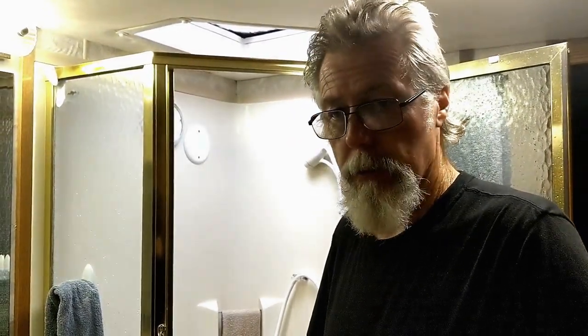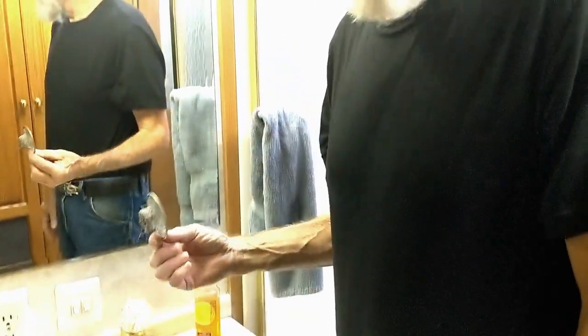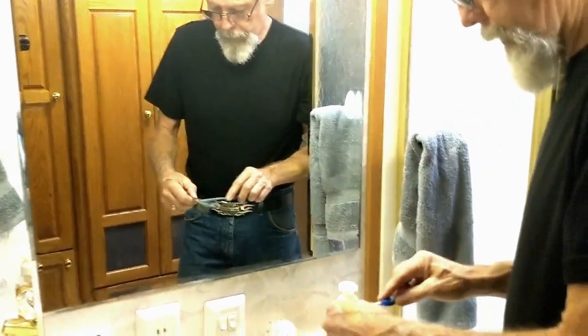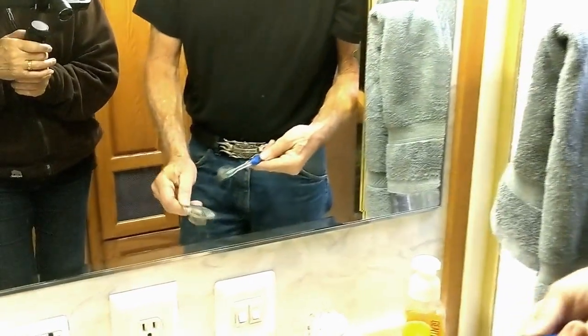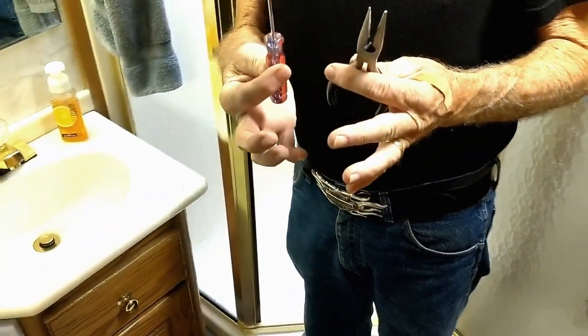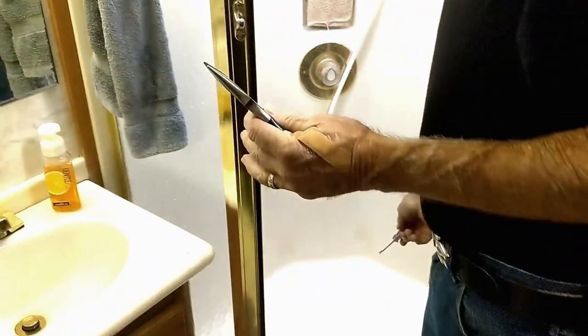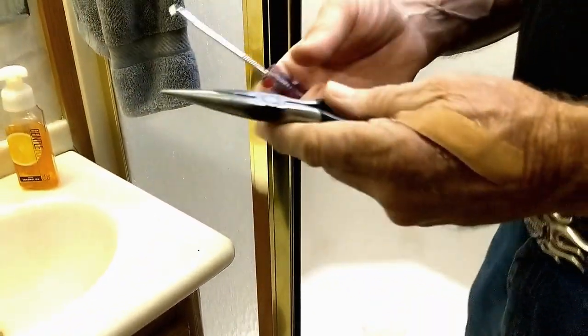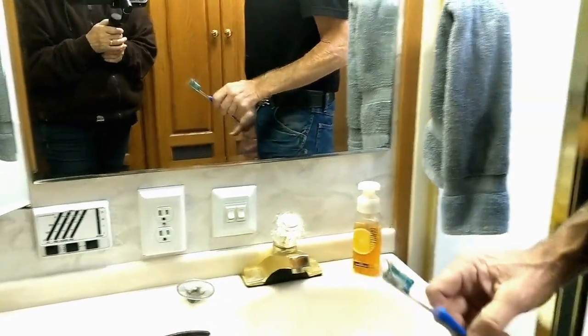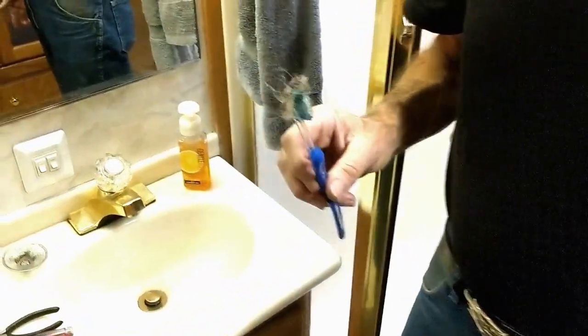With Darla and I we have a lot of hair, so it's always a battle to keep the drains from plugging up. The plumbing is a lot smaller on an RV than in a home, so they plug up a lot easier. A little trick — you can go to the dollar store, Walmart, or RV stores and get these little drain screens. I use one to get the hair out, which sometimes I have to do a couple of times a week. Two other tools you should always have are a pair of needle-nose pliers and one of these little hooky deals, because sometimes hair still gets down past the screen.